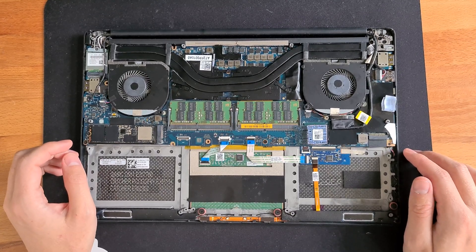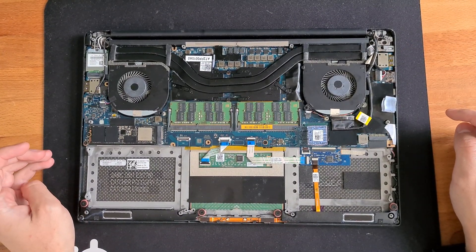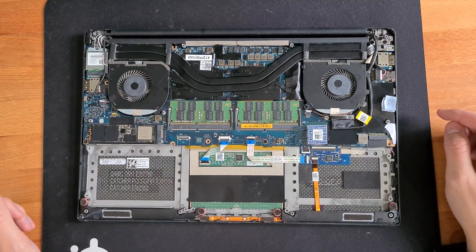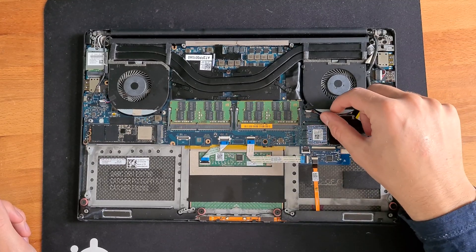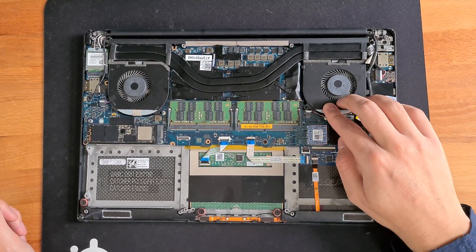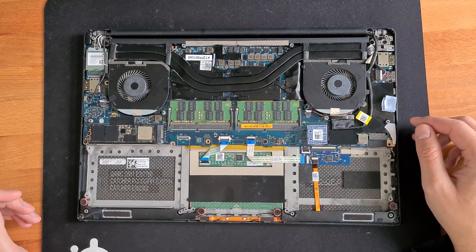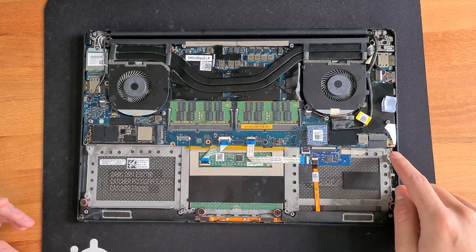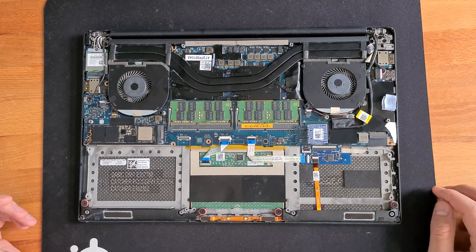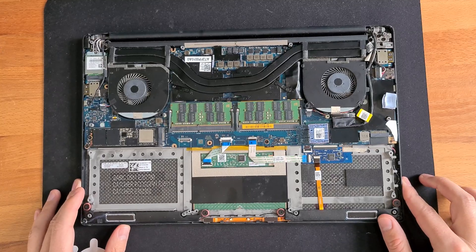Update on the XPS: I was able to get the heat spreader for the unit, which is a slightly different one, but I could get it pretty cheap. For the fans, the left one you can probably get away with, but the right one — the shape is quite different on the bottom — so it's not seating very well. I ordered new fans for about 25 euros. One thing also missing is a little audio board that belongs here, and I was able to get that cheaply too. I'll put the parts I needed to order in the description so you can see what's needed.